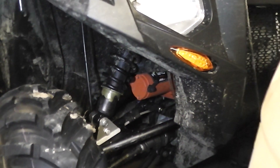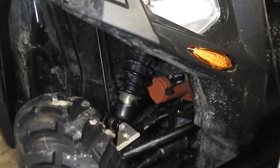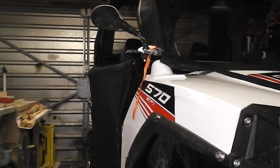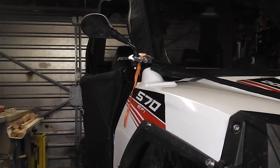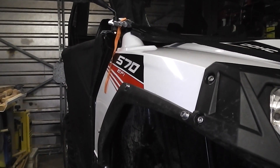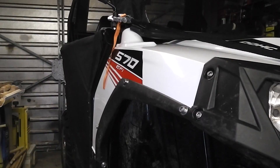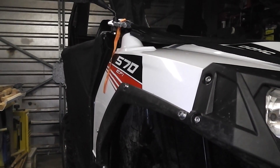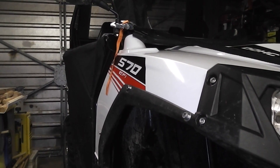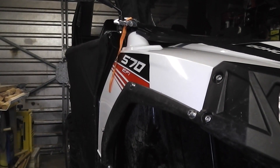So there we are: winch with synthetic rope, two-inch suspension lift, alloy wheels, anchor tyres, aluminium doors, canvas top, windscreen, tow ball, and obviously binning all the plastic tabs. And the dual battery conversion — putting a PC925 Odyssey in as the starter battery, a split charging system, and using the original Polaris battery as the auxiliary, which is only used on the winch at the moment.